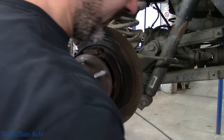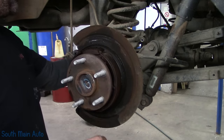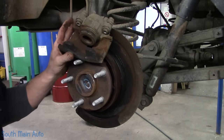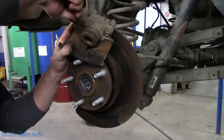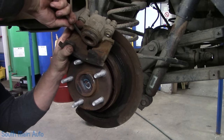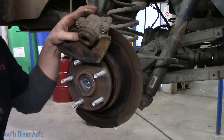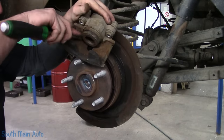One viewer complained about how wasteful I am with brake clean. I told him it's $1.98 — that was pretty much all I told him. Before you push the piston in, you do have to get some of the metal debris off the rubber boot, because you don't want it getting all folded up in there causing problems. The metal shavings are magnetic.